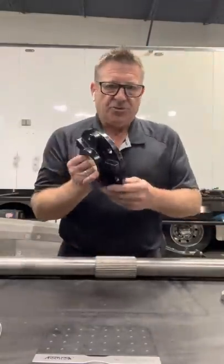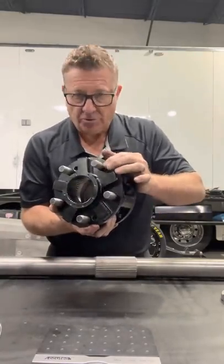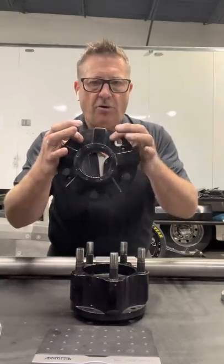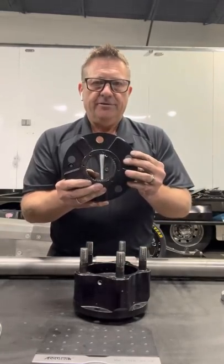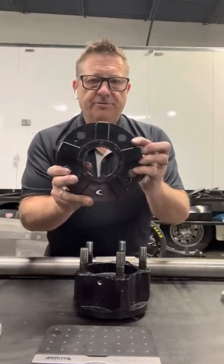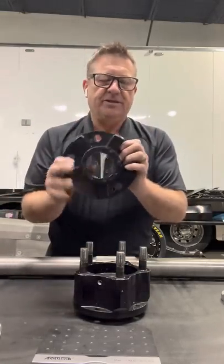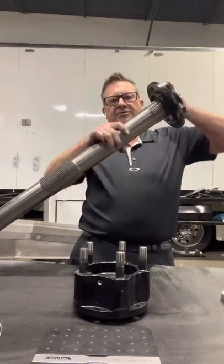I want to talk about this drive hub. The drive hub sits on this and bolts down — this is how the wheel is kept on, via the lug studs. On normal cars they're actually driven from the studs — the studs are what turns the wheel. Not in our case. We had a situation a while back where it sheared the studs off, lost the tire, and the tire and wheel flew off into the crowd. So they decided to change it more to where it's driving off these lugs — the studs just hold the wheel on. These lugs are basically like a gear into the actual wheel.